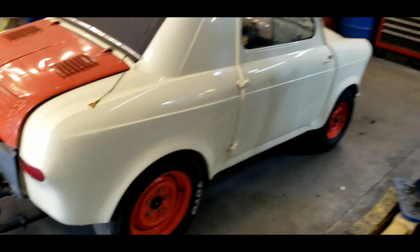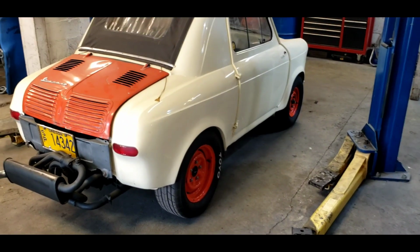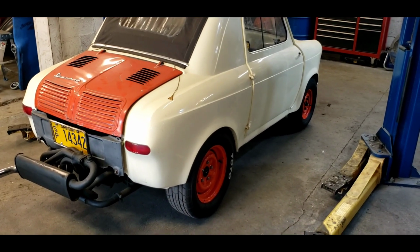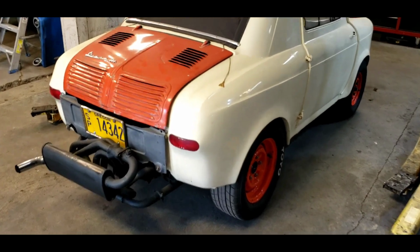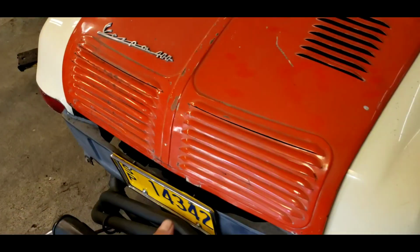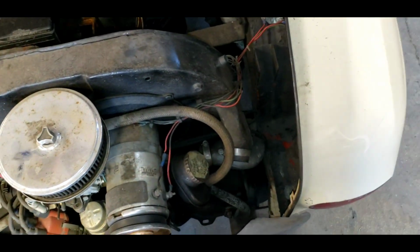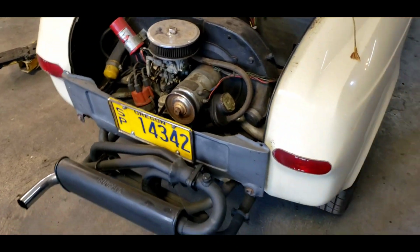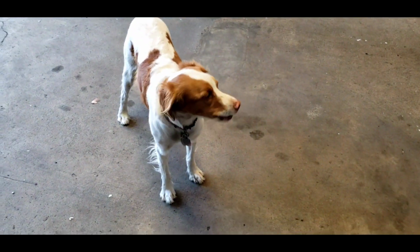It's been down for, gosh, 6 months, I think. This is my Vespa 400 with the Volkswagen engine. It was a two-stroke car, so we're getting closer. This originally had a 395cc two-stroke engine, two-cylinder. It now has a 1600 dual port, and it's pretty tired. It's starting to leak some oil at the rear main seal. I think the crankshaft has some end play.